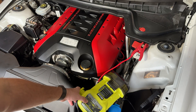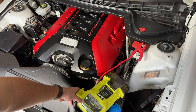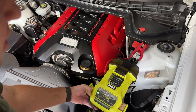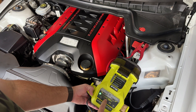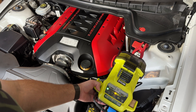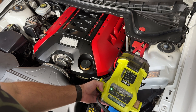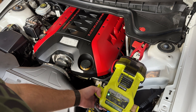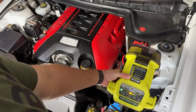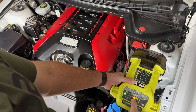It does say when you power this on — holding it down to power on — with just a battery that's a bit low, you just press the priming button once and it'll beep a few times and actually prime up. When it's done priming up, you'll be right to start the engine. This should turn green when it's ready to go. It does say it takes up to 60 seconds for a low battery, but if it's dead, it says to actually hold this down and it'll force it.